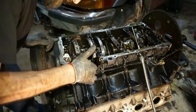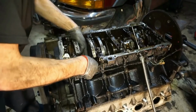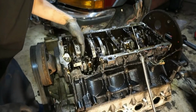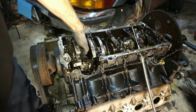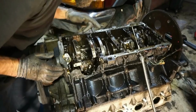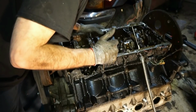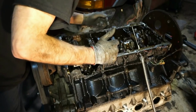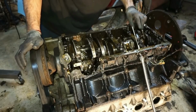Alright guys, so this one actually happened in between the transmission breaks. The pump went bad, I rebuilt the transmission, and then I did this, and then I broke the transmission again after I got done rebuilding this engine. So what I did to this engine, I decided one day that I wanted to try running the wastegate with no boost reference. I wanted to see if back pressure alone would open the wastegate and just see what it did, which was clearly not a great idea.